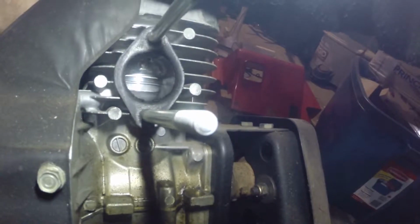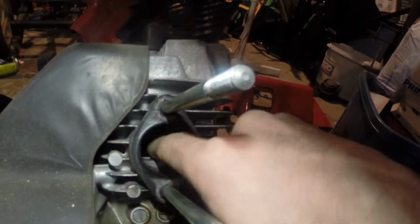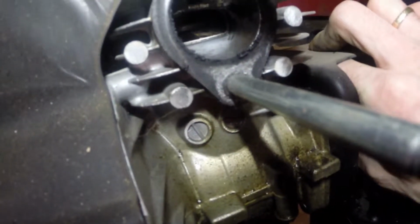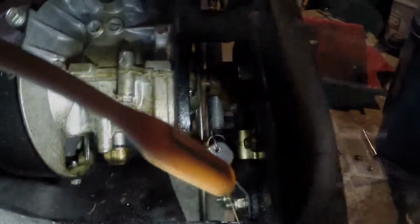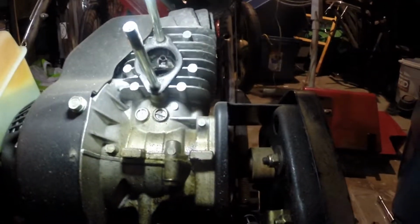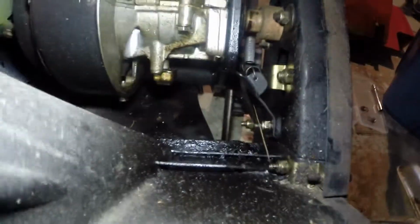This is gonna be real hard. Oh. Got a pretty dome on it, that's for sure, but it's pretty much clean. A little bit of carbon buildup on top of the piston, not much. Looks new. Except for a little bit of carbon in there. Where's all that coming from? The exhaust? Yep. Nice. Not really, I don't like that. I mean, this has barely been run. I don't like that.